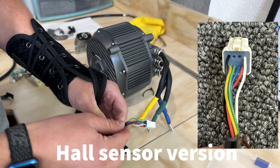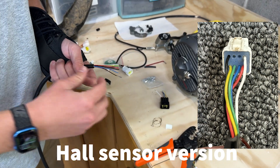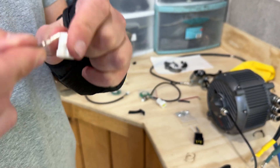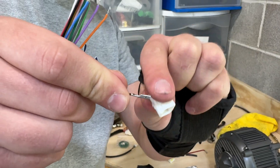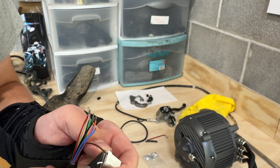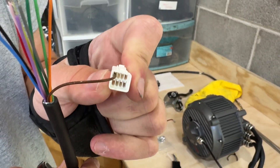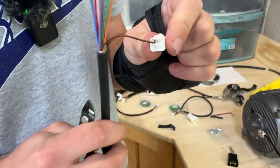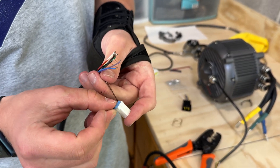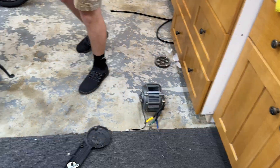We'll flash the wiring diagram on screen showing where each color goes on your connector, then you should be good to go wired into your X. Make sure you put each wire in the right spot because it does matter. Start sticking your seven wires into the blue insulator piece so water doesn't get in. Then one by one start inserting your pins into the connector — there's a little ridge that goes on top — and use a plier to push each pin all the way in without cutting the wire.